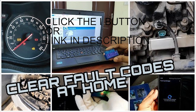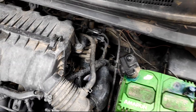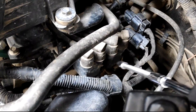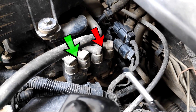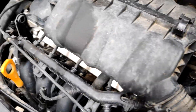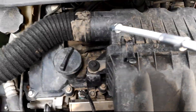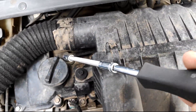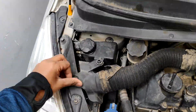If you want to do the same, or want to diagnose or fix a fault in your vehicle, check out my video on how to diagnose your car by clicking the i button above or the link in the description. Coming back — to ignite the air-fuel mixture, the engine needs spark produced by these ignition coils. Here there are two of them, lighting two cylinders each. If you follow this lead, it will lead to the spark plug well. Here you can see two of the leads; the rest two leads are under the air box. If you remove these leads, you can access the spark plugs. Let me quickly remove the entire air box so that I can show it to you properly.